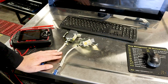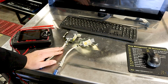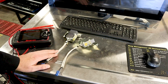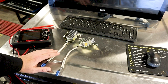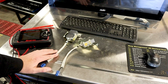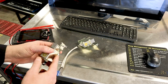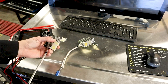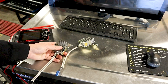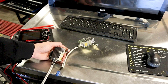If the resistor shorts out or blows out, this could cause an issue with the pump not coming on or possibly limiting the voltage getting to the pump. This is powered directly through the high-speed relay for the pump — the pump has two relays, one for low speed and one for high speed, and this is the high-speed side. So this is some type of current limiter. It does have a heat shield on it, so it does get hot, and it's mounted up in the dash with nothing around it. I'd recommend putting it back exactly where Toyota put it. I know it's sometimes tempting to just zip-tie it somewhere — as I saw on one of the threads on Prius Chat — but put this back with the 10-millimeter bolt. It torques down to five newton meters; just a little snug should be good. Zip back up the dash and be ready to go.